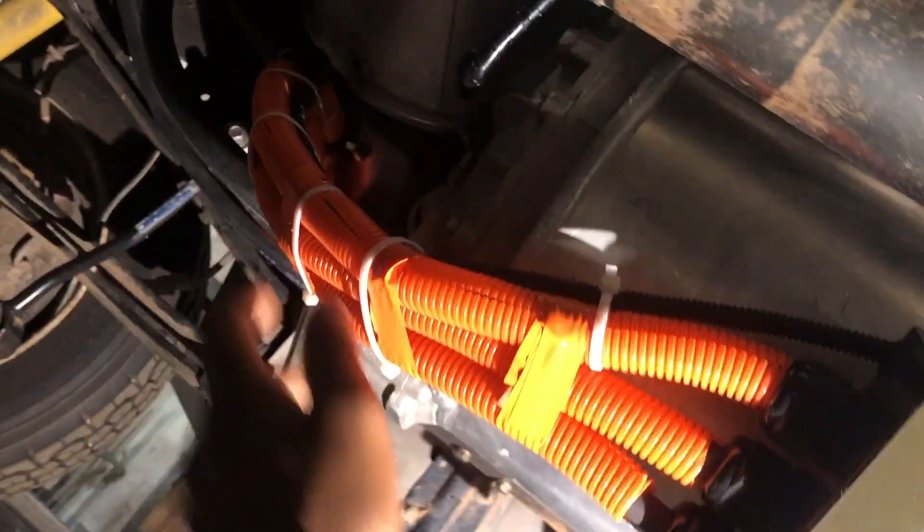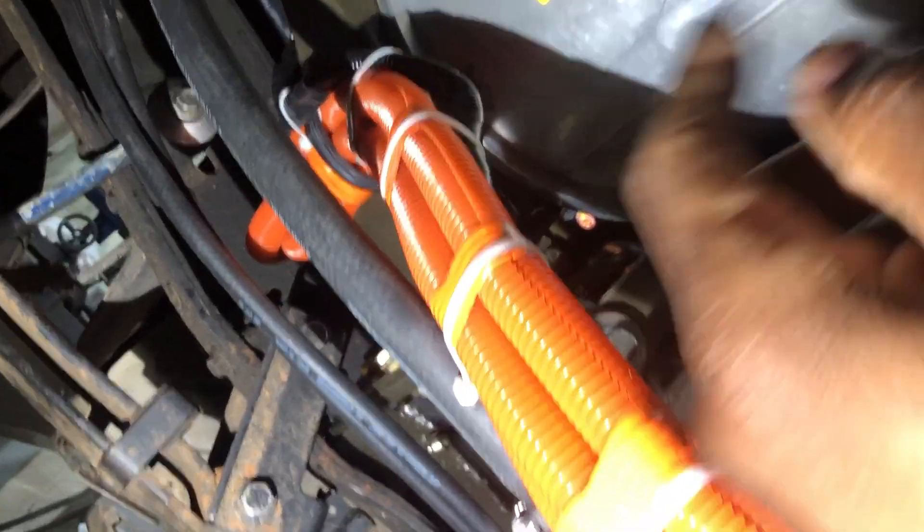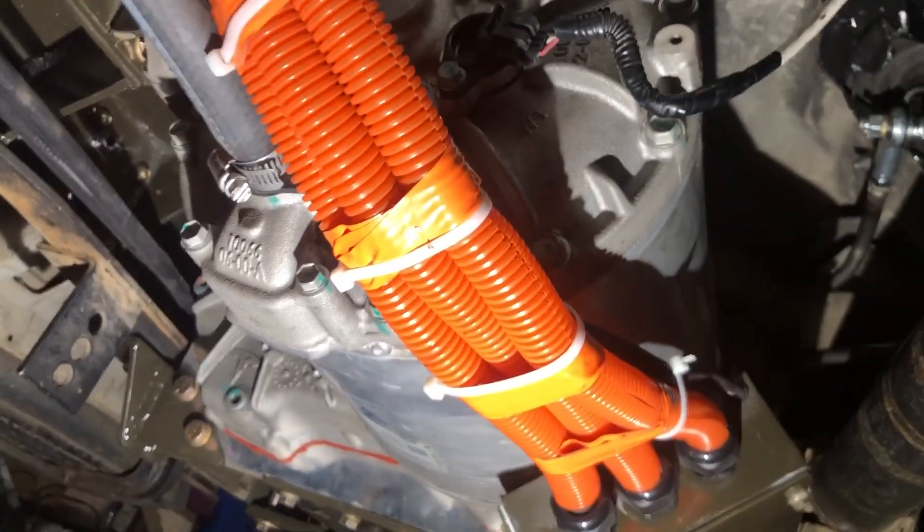This is your drive shaft. This is your transfer case. The transfer case comes up and connects to the motor — this is the Tesla motor. This is our homemade strain relief box for the AC side coming from the inverter. There's your inverter, which has its own mount and separate cooling lines. That's your shielded encoder, which communicates with your inverter so it can tell the motor what to do. This is your battery box — that green box there. And this is your high-voltage DC line that goes from your charger along the frame rail and up into the battery box.